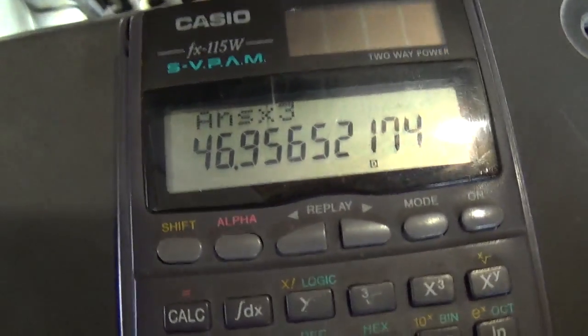So all we need to do is multiply this by 3, and we are about 47 degrees retarded on our intake camshaft, which is exactly what we deduced from our pressure transducer waveform. Now, that known good cam crank correlation that Keith sent me, I think that might be for a different year engine. This is a 2010. I think he sent me one for a 2011, and we know that manufacturers always change these little details between years.